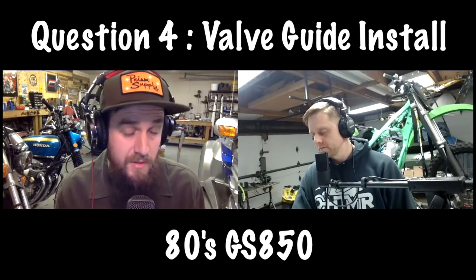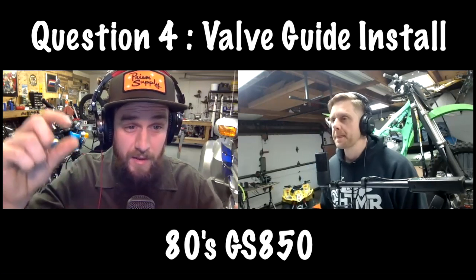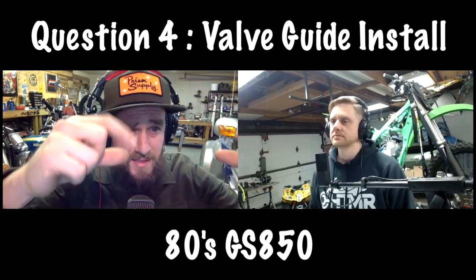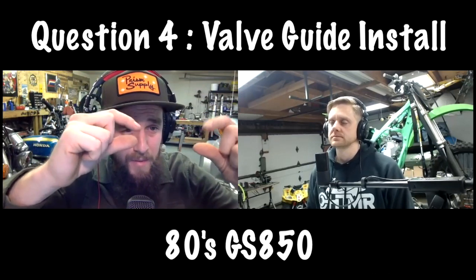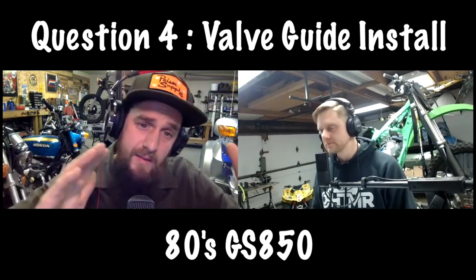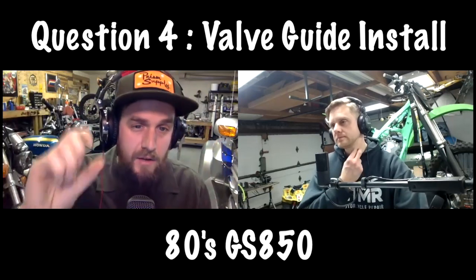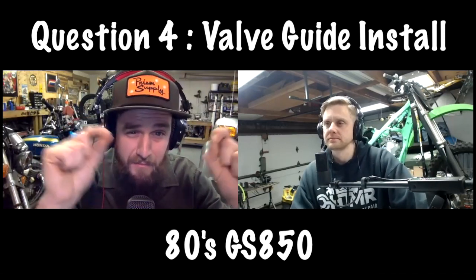And it'll be a learning experience for you to see, okay, what should it look like in your book? They'll give you some kind of image or picture of how big the contact patch should be on the valve seat. And if it's wrong, if it's like this, it's right, if it's like this, and how high and low it is, you're coming down to half a millimeter, you know what I mean?